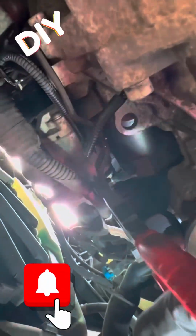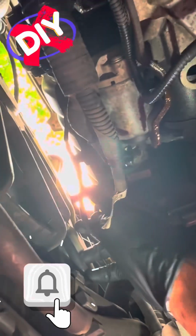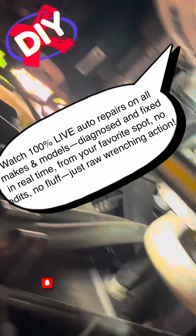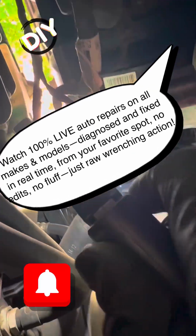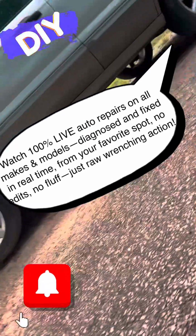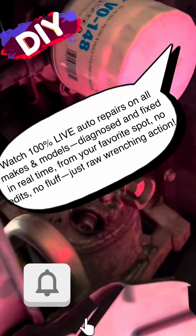Then I just take my Milwaukee pliers or needle nose, and I'll push the harness out of my way so I can have more access. That way, you can see in a second how I reach up and bend that metal bracket downward. If you bend it all the way downward, you can actually slide it off the sensor. So much easier. So I just unplug it from the top. Then I take the metal bracket and bend that downward. I'm about to show you in one moment why that makes sense to do and why life gets easier.